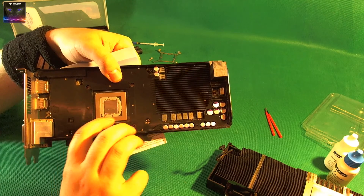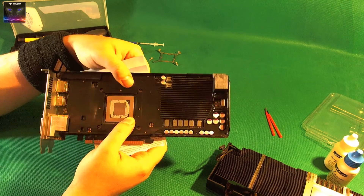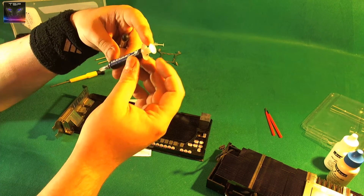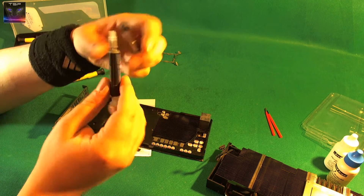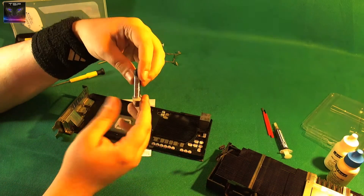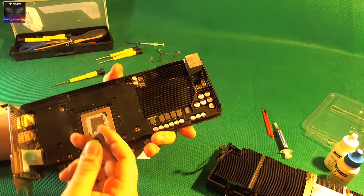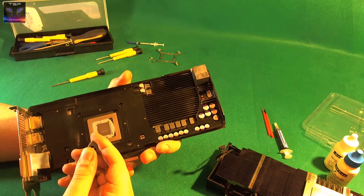I think that's clean now. Looking at the design, these edges should actually be filled with thermal paste. I can't put Liquid Ultra in there because it conducts electricity — there's a circuit port there. So I have to put actual thermal paste on the edges and then put the Liquid Ultra in the center. I have IC Diamond and Arctic Silver 5. I'll use Arctic Silver 5 on the sides — because if you don't fill the edges, air gets trapped and it heats up.